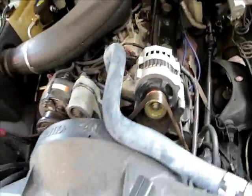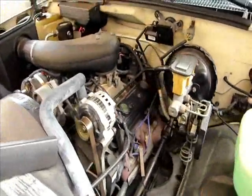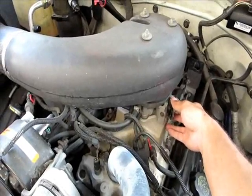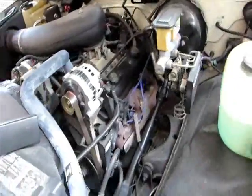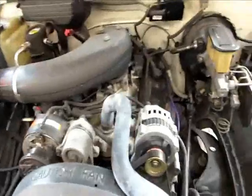You really should do this when the engine is hot too, but this engine's not very hot — I'll see how it is; if not, we'll screw with it again. I've reconnected the connector and you'll see it's running a lot better. Give it a little bit of gas and rev it off. I still need to take that manifold off — this thing is worn out. Now we're going to show how to clean out the throttle body and the IAC valve.